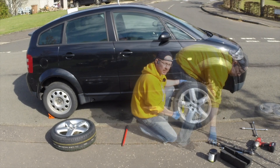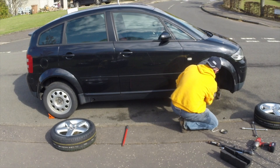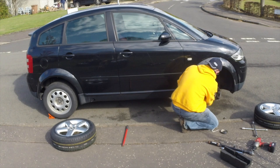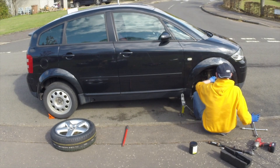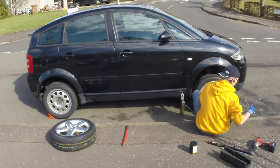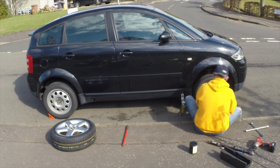Before I put it on, I'm going to put a little amount of copper grease onto my finger and around the mating surfaces here to make sure it doesn't get too stuck and is easy to take off next time. I'm also going to put a little bit of copper grease into each of the bolt holes to make sure they don't rust. Then I can take the wheel and pop it on — I find it easiest to hold it with my feet. Put it onto the centre, use our tyre iron — 17mm — and do each nut just tight enough to hold it.